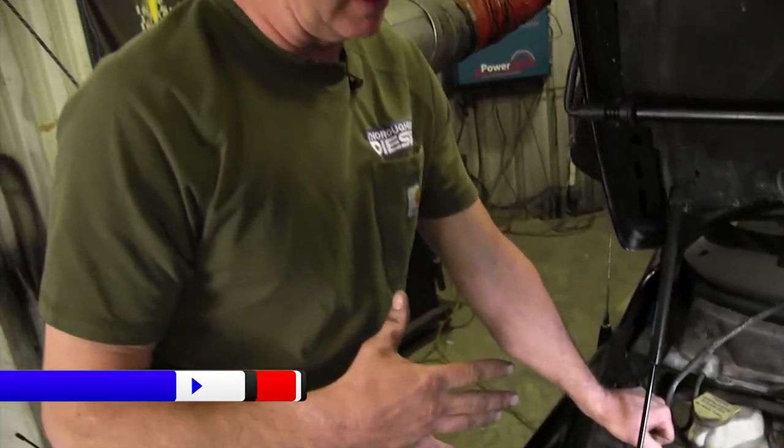And one thing that really helps make that process faster and easier for you is to take the passenger side fender well out. Now, I don't know what it is about fender wells, but guys just don't like taking them out. They damn sure hate them on Fords and Dodges as well. This fender well on these common rail trucks is pretty easy to get out. It takes maybe 5 minutes to drop it out, and it gives you a lot better accessibility to the turbo to be able to attack things like the clamps on the downpipe, the oil drain tube, the oil feed tube, things like that. The shock tower's in the way, but you can work around it. But that's my advice to you, is to take the inner fender well out.